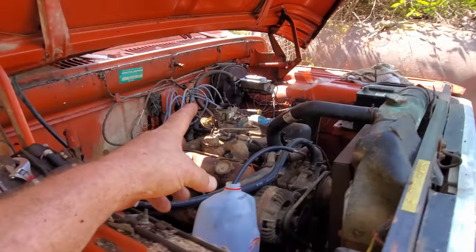All right, I got my fuel line hooked up to the carburetor now. And I couldn't see my line over here on the flywheel. I ain't got no sandpaper. I ain't got nothing to mark with. So all I had was some pipe dope. So I just filled the crack in there and wiped the excess off. Maybe I can see that. Let me fire it back up. Make sure it's going to run off of this. Make sure this don't leak. Set the timing. And then all we got to do is pump this tire up and hit the road.